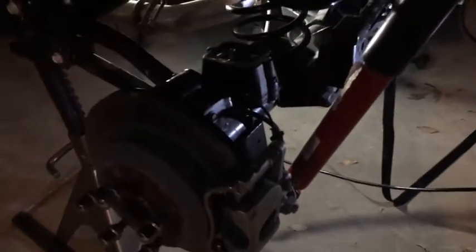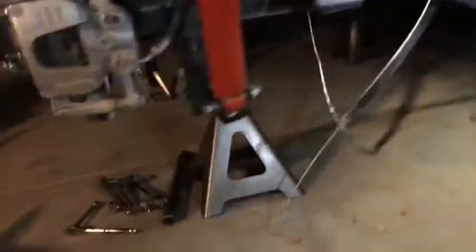On to the next step. So, jacked up the axle and hooked up the drive shafts. I mean, set the shock absorbers on both sides, so they're in. Oh shoot, it's dark. Also seated these in the right positions. It's clocked just like the back. I don't know if I showed you, the spacers for the bump stops are in. Anyway, so ratchet strap time. Hooked up the ratchet strap to this side right here, and it goes over here.